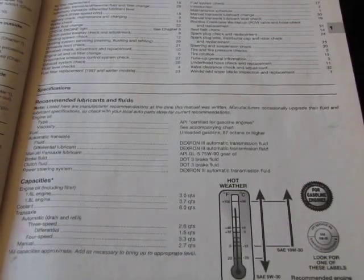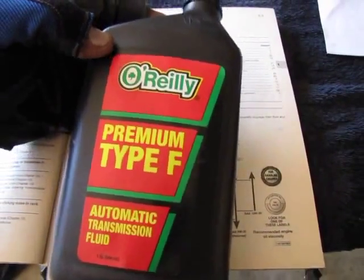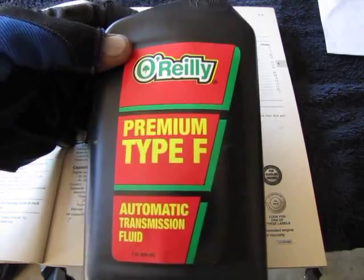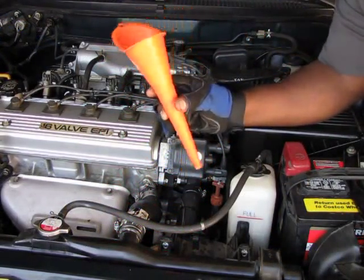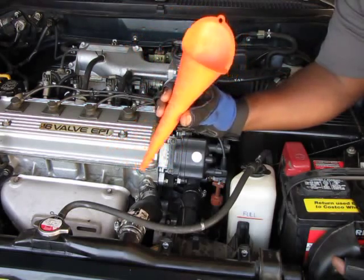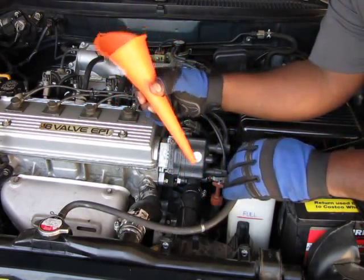So now all we have to do is get our nice new automatic transmission fluid here and install it. 3.3 quarts. See you in the car. Another note, whenever you're going to change your automatic transmission fluid, because it's refilled through the dipstick, you want to make sure you have on hand a nice narrow-nosed funnel that'll actually fit in the dipstick hole.